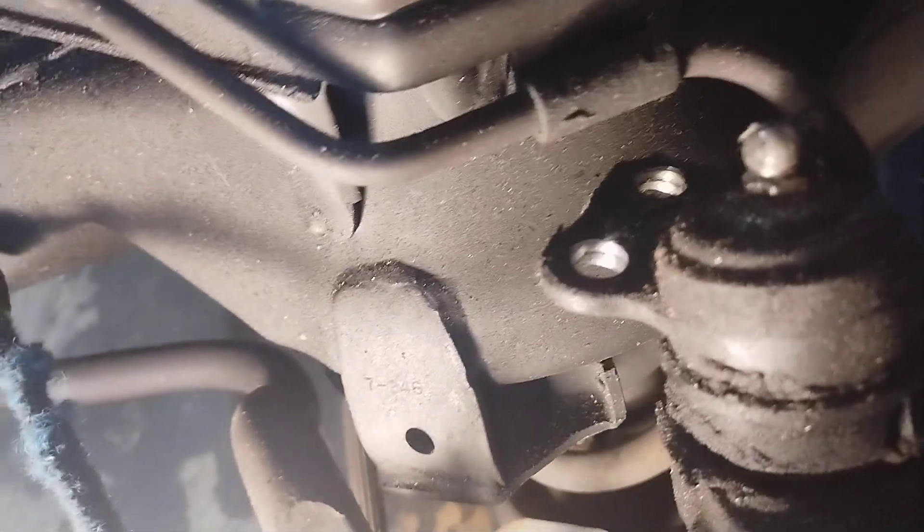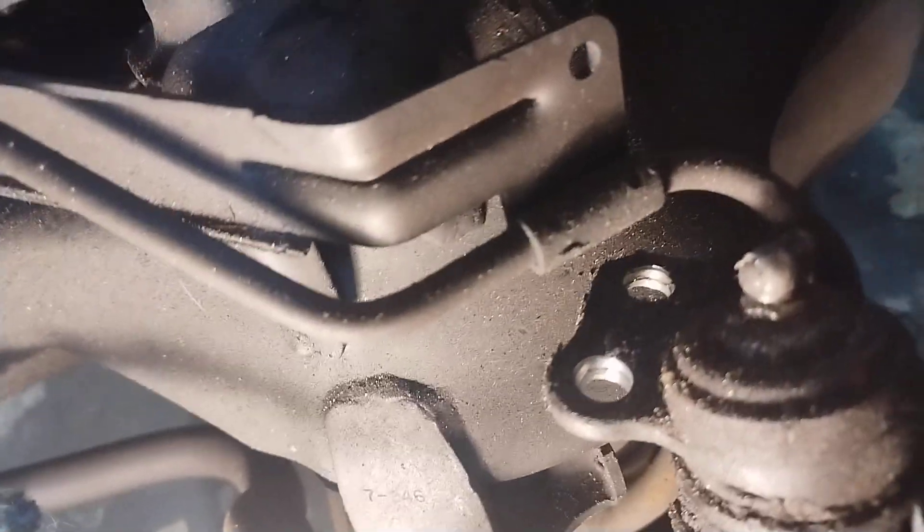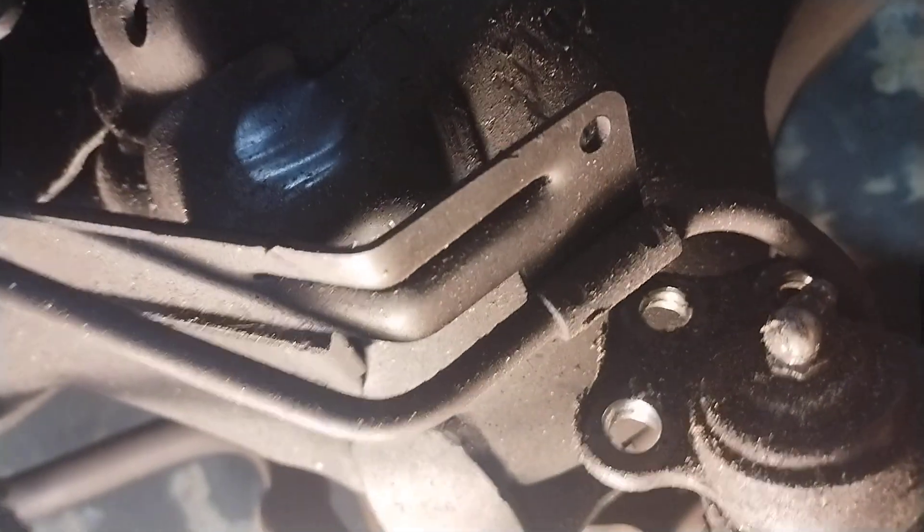I strapped the brake hose because I don't want to hurt it. You can see this ball joint — I already mentioned the boot. You don't need to worry too much about that because you can grease it, and as long as you keep it greased it'll be years before that ball joint goes out. It's already been replaced.